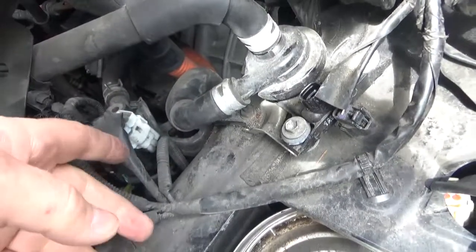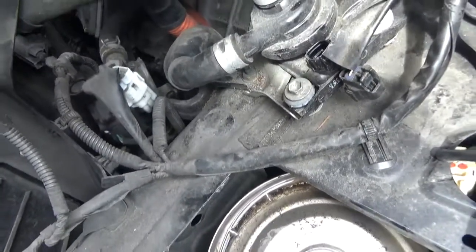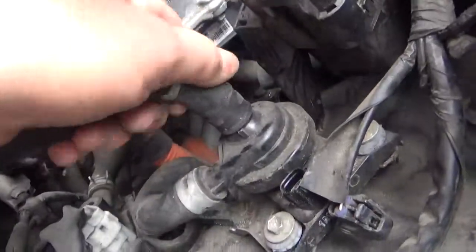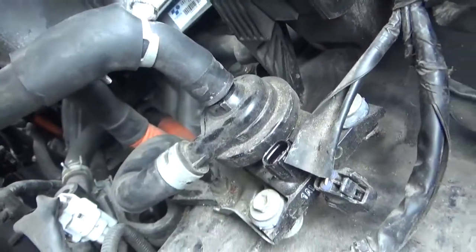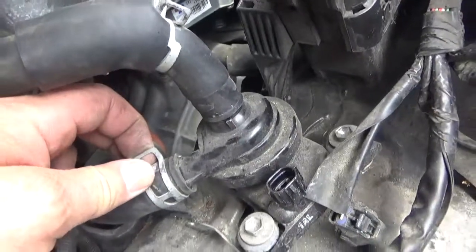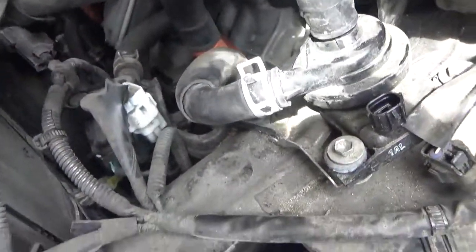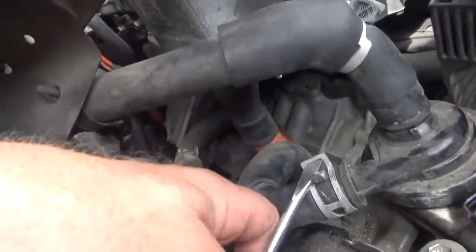And then I'll put them on like that onto the new water pump, and then take the clamps off. So with this clamp slid up, I'm going to raise this up a bit, put a clamp right there, and do the same thing to this one. To get to the point where I could actually pinch this and remove it, I had to slide it around the hose here by hooking, you could use a screwdriver or anything in here just to kind of pry it back